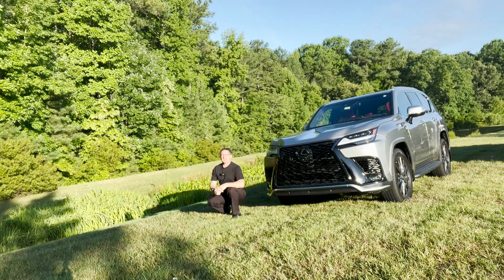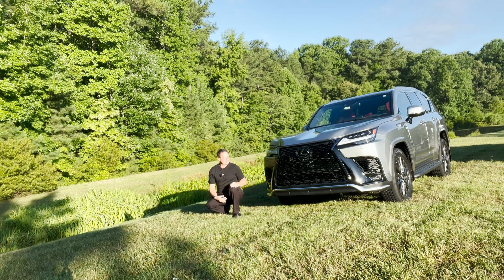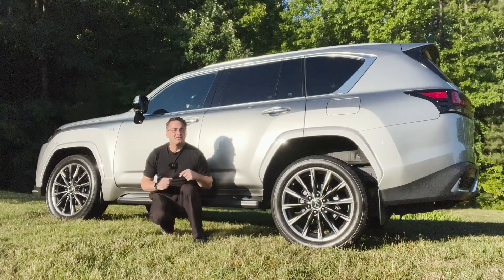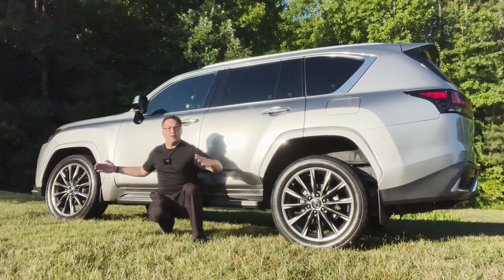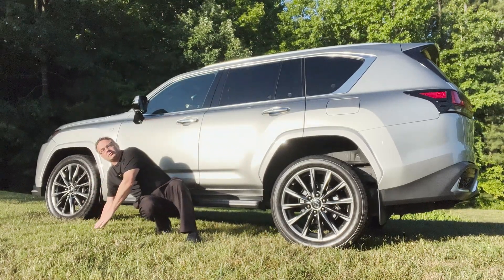So let's say we're out here in the wilderness and all of a sudden you encounter an obstacle like slippery mud or uneven territory — things like that, like a rut, a divot, a hole — anything that could prevent your wheels from powering through that rough terrain. Your vehicle is going to go for the least amount of resistance, so if the front wheels are spinning, it's probably going to try harder and harder. But if you have a center locking differential, things change. Now with power distributed evenly, both sets of back wheels and front wheels are going to turn the same revolutions, do the same amount of work, and then you can power through your obstacle.